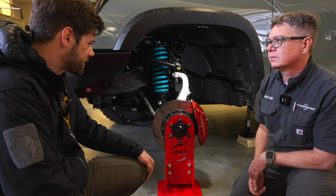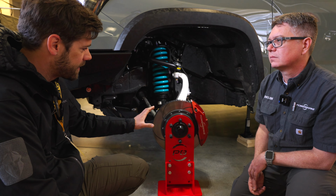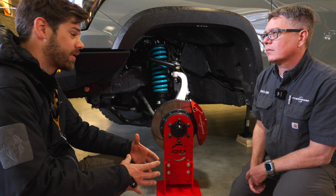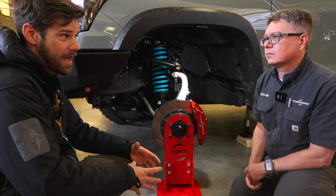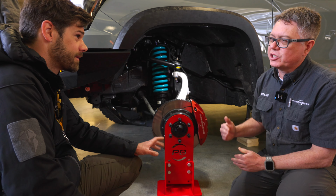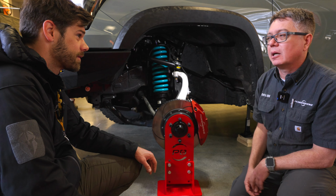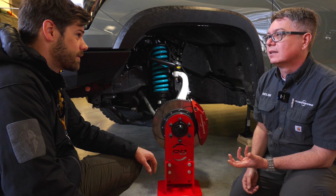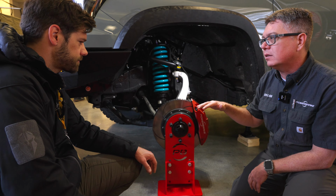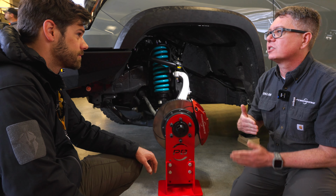Awesome. And so as far as how many miles do you get out of these things before they need an actual rebuild? Because I know a typical caliper is going to need a rebuild, but because you're not using all the rubber gaskets and stuff like that, I'm sure they go for a very long time. Yeah, mileage is really extended by going with the bigger brake kits. And remember, you're also running cooler. And heat is always our enemy in a brake system. So the cooler we run, the more things start to last, right?